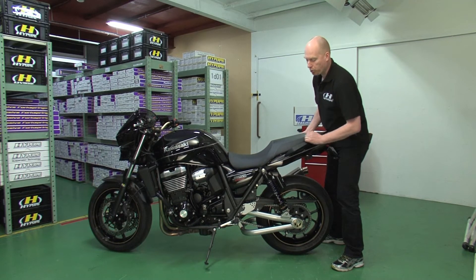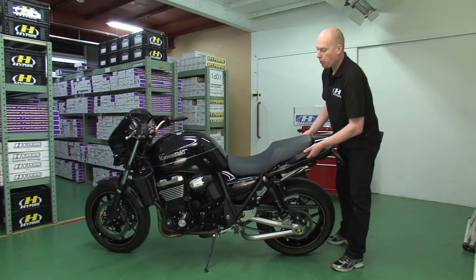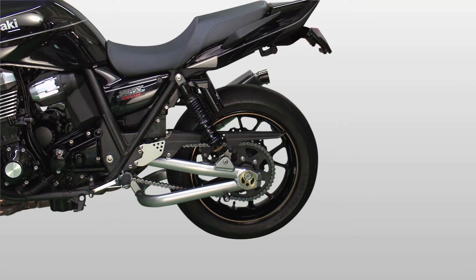Then I want to know how much sag there is. To measure this I have to make a reference point. I measure the length of the swingarm from the center of the axle — this is the pivoting point. When the wheel moves up and down, the wheel is actually moving around this position in a small curve. I measure from axle center to center point, moving this point up because the axle travels in that direction toward my reference point, and there I make a marker.